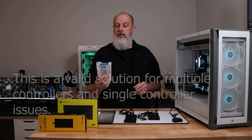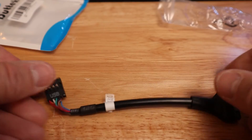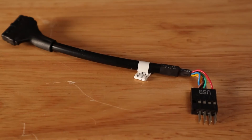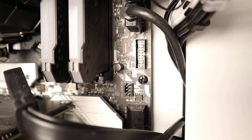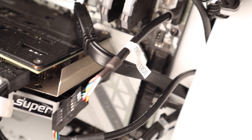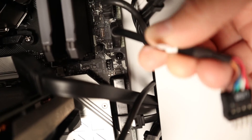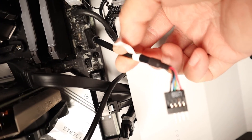In that case, you can use an adapter cable to convert your USB 3.0 header into a 2.0 header. USB 3.0 has more efficient power delivery, which may be why this helps. I've never needed to do it myself, but I did test an adapter cable — the controllers are detected just fine. I'll link to these in the description. They're relatively inexpensive, around eight to ten dollars.